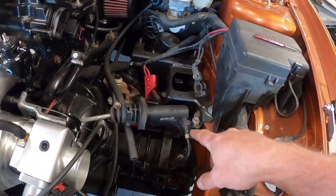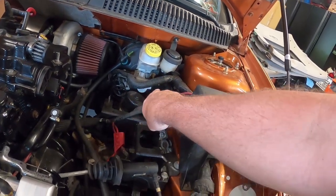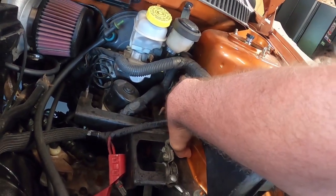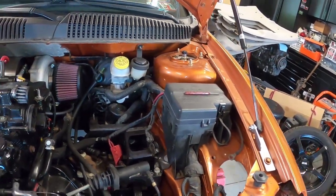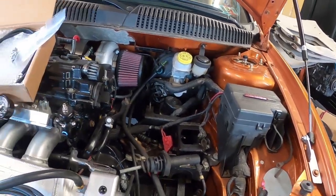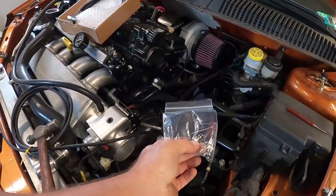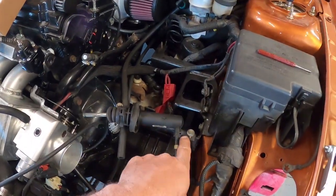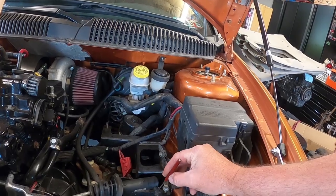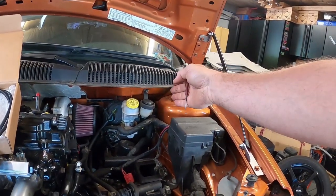Like I said, I'm gonna pull this apart, I'll let it drain while I'm unbolting that, and then once I pull that out I'll get it past this wiring. What I'll probably end up doing is just cutting this plastic line — you can see it right back here in front of my fingers — and then I'm just going to pull it out. I'm not reusing this stock line; I have plenty of them if I need one, so I'm just going to discard it entirely. Then we have to install these fittings, these o-rings down in here, and then reinstall the roll pin. I have a punch that fits right in here — I'm going to give it a little tap with the hammer to disconnect that, and then I'll show you what it's like trying to fight that out of there.